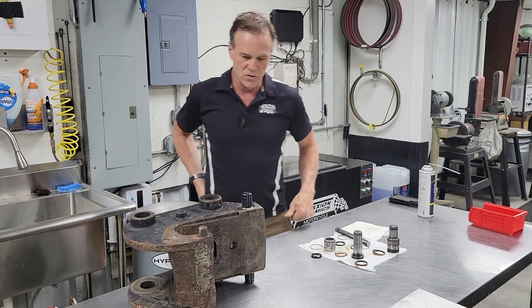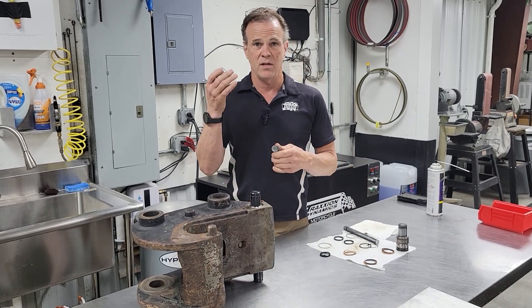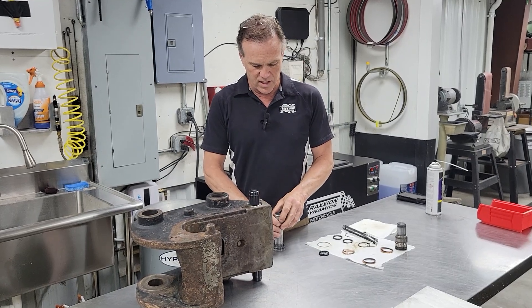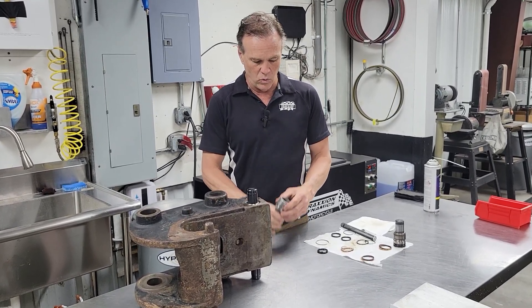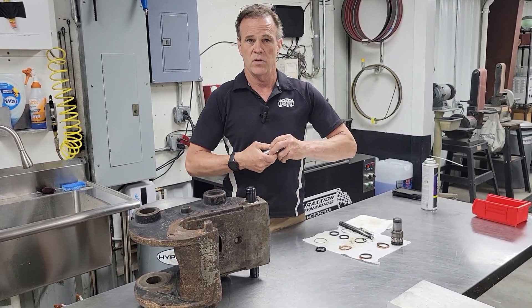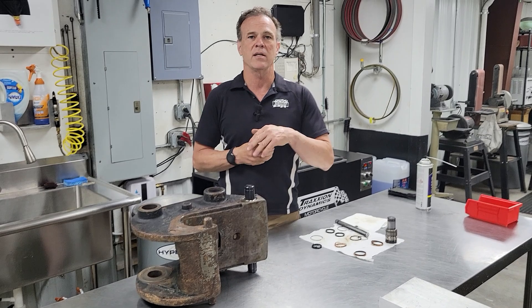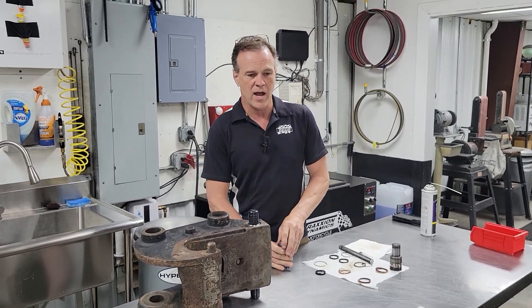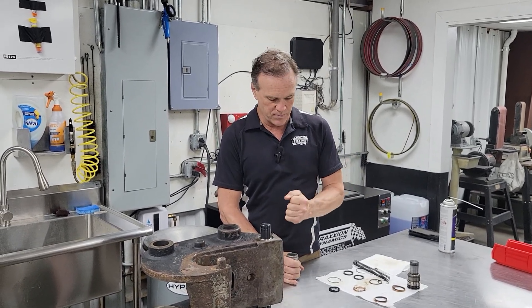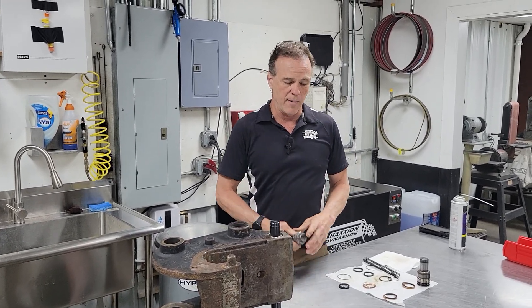That orientation is the trick. These fit together incredibly tightly when you have a new piston, a new bearing, and new seals — very, very tightly. So grease everything nicely. You'll be able to work the first seal over the head with some effort. The second one, once everything fits tightly and is lined up, they're fit so tightly that you can't actually rock it. You're just going to have to go back to your socket, get very square to it — as perpendicular as you can — and push very uniformly and evenly with effort, and wait for that seal to drop over. It will fit very, very tightly.